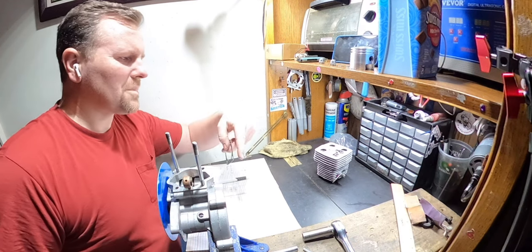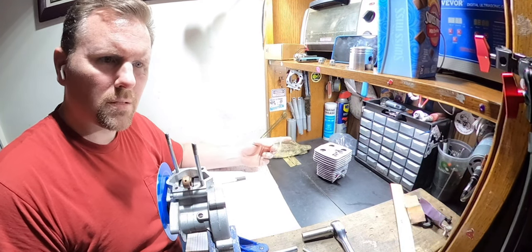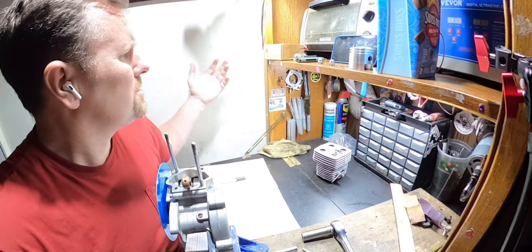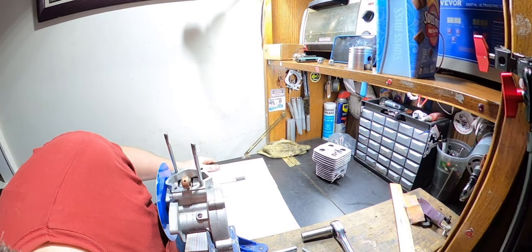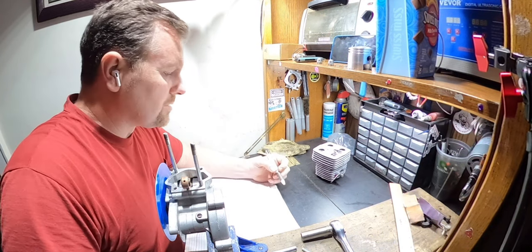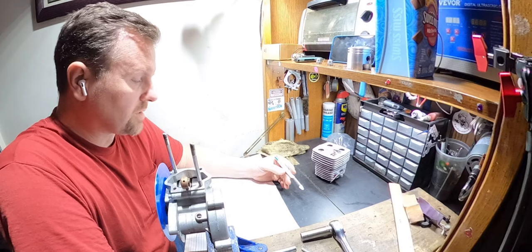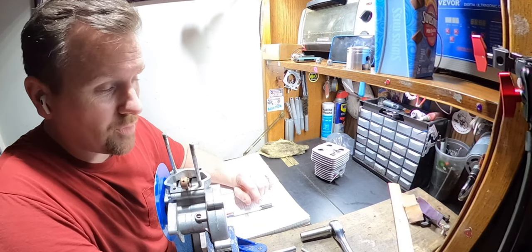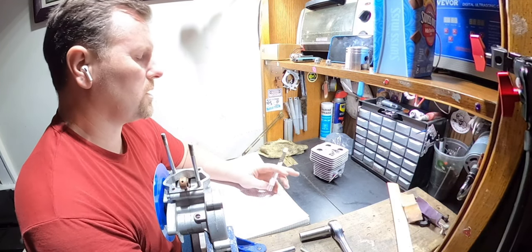Boy, am I talking myself out of doing it or into doing it? Sounds more like I'm talking myself into doing it. Why? This is why I can go ahead and do this nonsense and destroy this guy's brand new motor and send him all this craziness. Mind you, Rob is not looking for a monster of a motor. He does not want a performance demon, and I don't want to give him one. I want to give him something that's reliable. But if you don't get the squish right, you can run into an overheating issue.